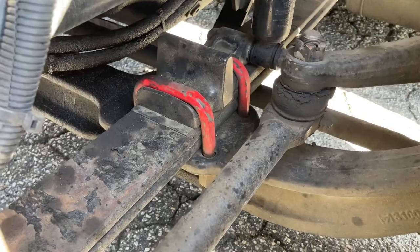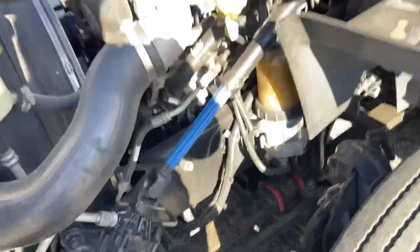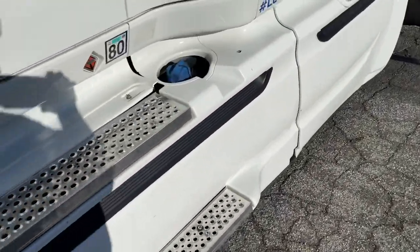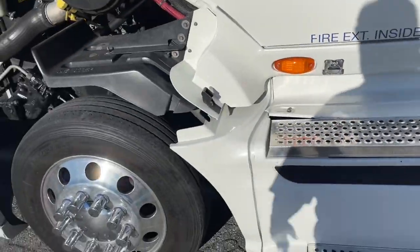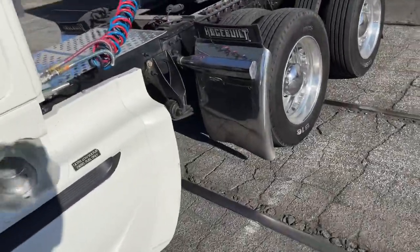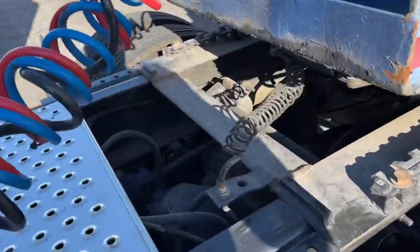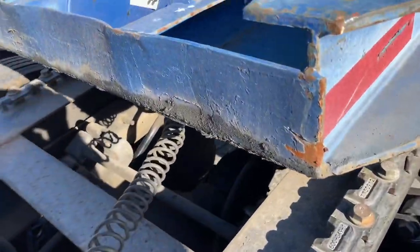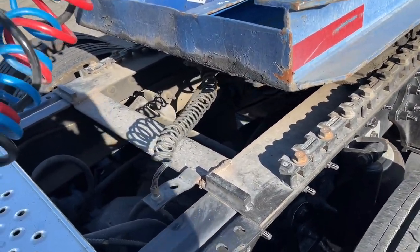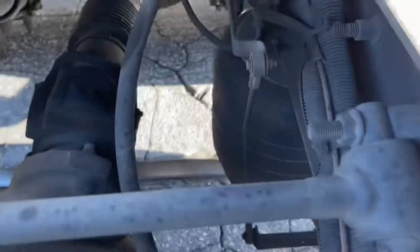You can see right here how we did it — same scenario on both sides. The shorter bolts from BETTS are about fifty dollars for the whole set: all four bolts, nuts, and everything included. Any mechanic should be able to do it — it's pretty easy to lower them, really not a big deal. It's no different than replacing a spring: you unbolt it and put it back together, just this time without the block.